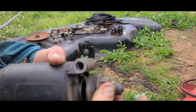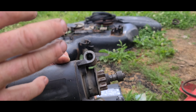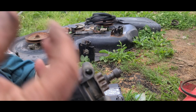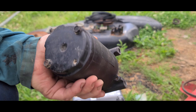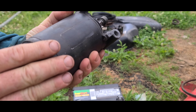What had happened was the starter stayed engaged with the motor and was either drawing amperage or voltage, or it was actually acting as a generator and pulling power out of the system. It was extremely hot — it's actually still hot right now. Just checking the condition of it, it seems like it really got damaged, but it was probably bad to begin with.